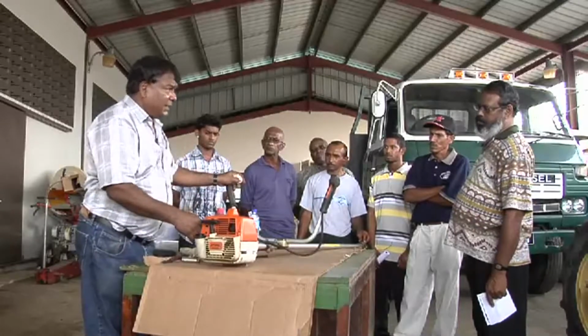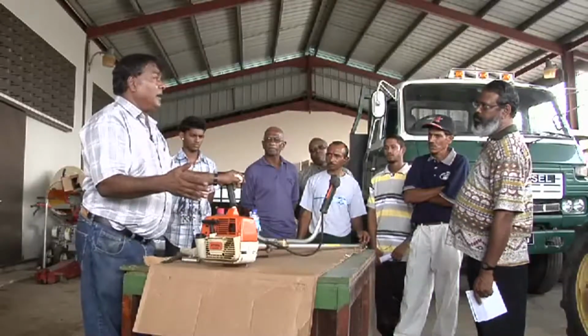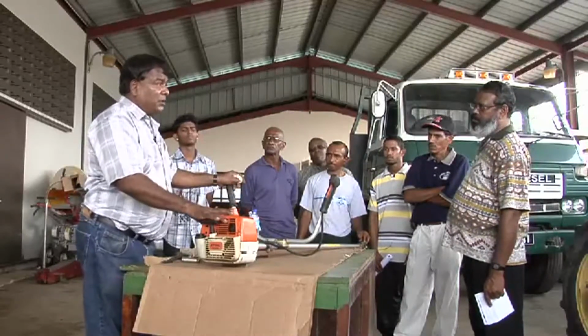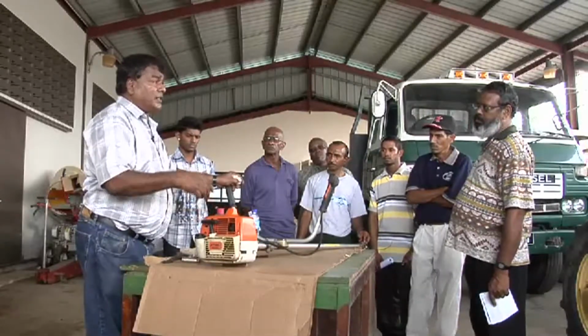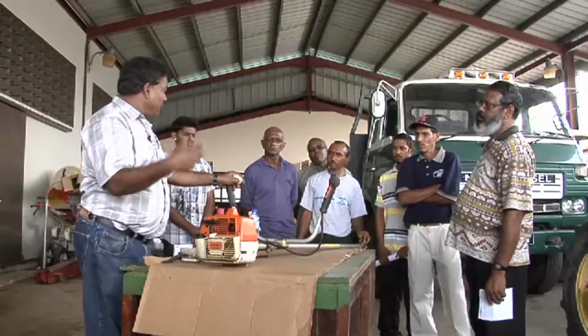You have an air cleaner that you're going to clean and replace if necessary. And you may have additional parts on your lawnmower, like examining your blades and so on. But generally, your air cleaner and your spark plug are critical areas. We say the air cleaner probably once a week or as necessary. The spark plug you can clean and gap every 25 hours or so. You don't wait until you have problems in the field.